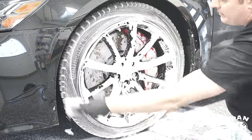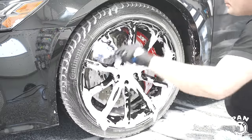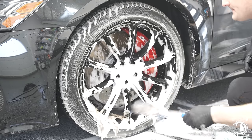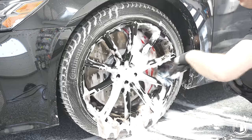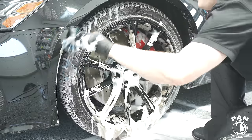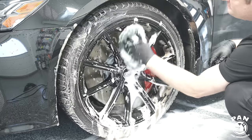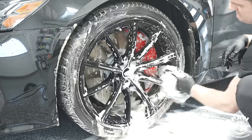We're going to clean now the wheels and tires. I'm using Brake Buster in an IK foam pump sprayer, diluted one part Brake Buster to three parts water. Then I'm using a tire brush to scrub the tire walls and an assortment of different brushes to clean the wheels. In this case, the wheels were in rough shape because these are winter wheels — rims from his previous Audi vehicle that he had for three years, so they've been through three full winters. They're fully scratched with a bit of dense road rash.